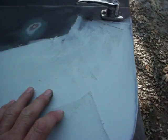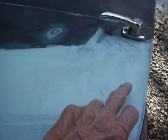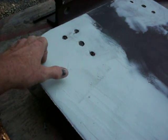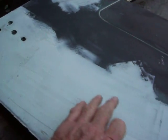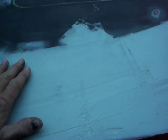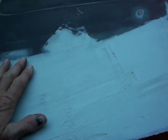It takes time because you're putting a tack here, you're putting a tack all the way over there, then you're putting a couple in here, and then you're going in between them. So it takes a while to do. And the same thing with the stitch welding. You'll stitch at this end, that end, a couple in the middle, and move around because you don't want the door to move and you don't want it to buckle.